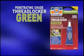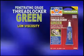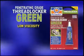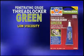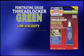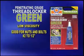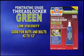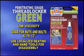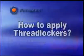The Permatex Penetrating Grade Threadlocker Green is a low-viscosity thread-locking liquid that wicks along the threads of pre-assembled fasteners to secure them in place. Since it's applied after assembly, preventative maintenance procedures are simplified. It's ideal for fasteners ranging from number 2 to 1/2 inch in size. To remove Penetrating Grade Threadlocker Green, localized heating and hand tools are needed for disassembly.